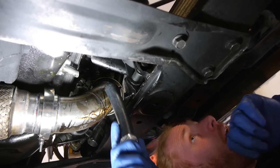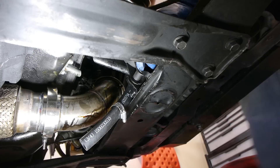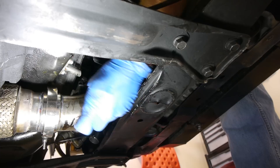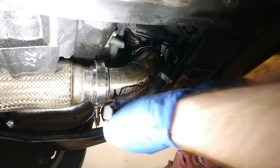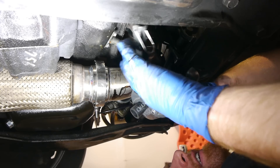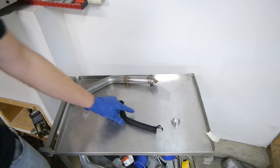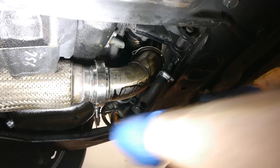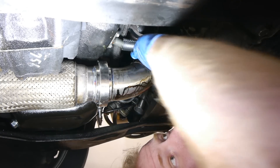While I was at the car parts store, I tried to find a 45-degree connector, but no one in town had one. I went to three or four different parts stores and the only thing I could find was a 90-degree. I'm going to avoid using that if possible because I don't want to impede the oil flow. Luckily the hose I found was flexible enough to make the curve without kinking. I hopped under the car, cut the hose to length, and it works perfectly. No more obstructing the oil return line.